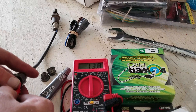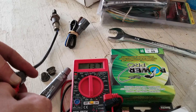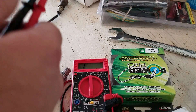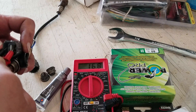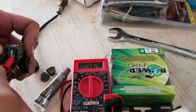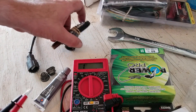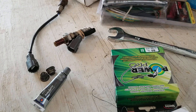If you look at the multimeter, it's going to settle in right at 13.7 — 13.6, right in there. But if you test the new O2 sensor, it reads 16.5 — that's a three-ohm difference. Three and a third ohms is enough to cause issues with your vehicle. It's enough to throw your air-fuel ratios off, enough to cause the goop buildup, and enough to ruin your catalytic converter.